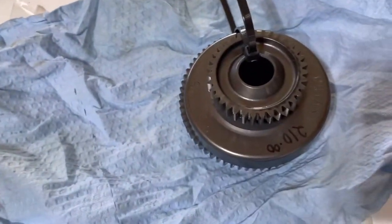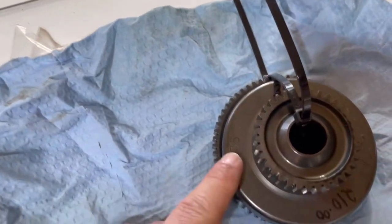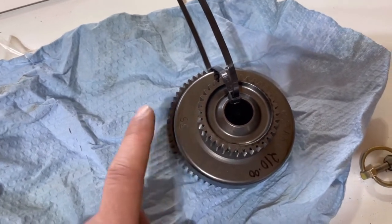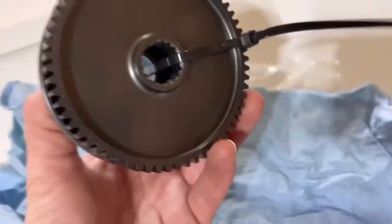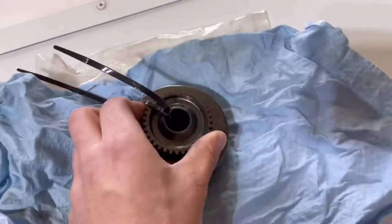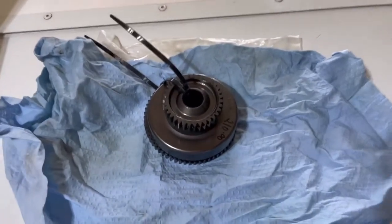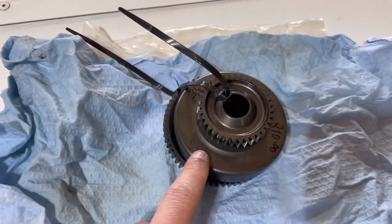We have to go through the motor and check what gear set is in this. Right here I have a 35 gear set. That's more like an option gear for our track. It gets you a lot more top speed, but you sacrifice in the tight stuff. These are inside the motor. They don't wear out like chains, but they're a lot more expensive. You can see I paid 210 bucks for this one. Generally, I want a 34 in there, especially to start off while it's windy and cold. We only run the 35 really on a day where we got other carts to draft with.